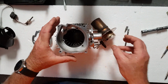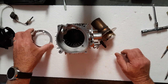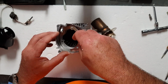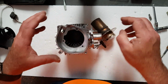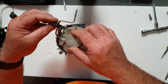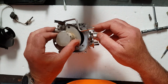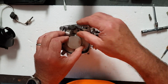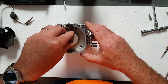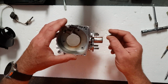Our unit was blowing smoke. I left the service run a little bit longer than I should have, but not long enough to cause it any real damage, or any damage at all. Now it's ready to go again, so we drop that gasket in there, line up the rubber seal here, slide it all back together, and then we just start putting it back together again, in the same sequence in reverse as how we got to this point.